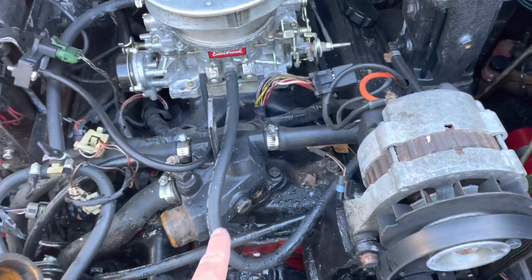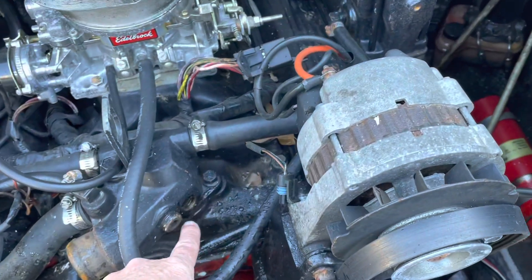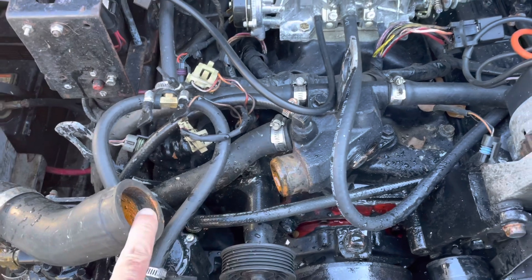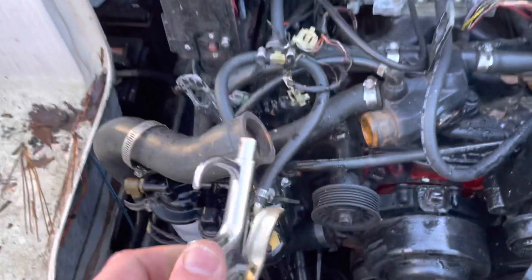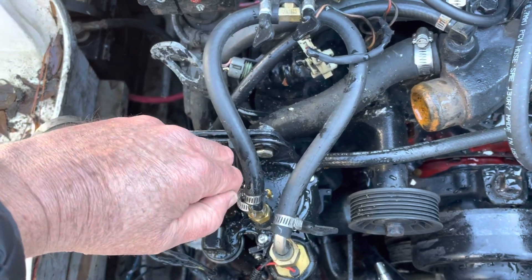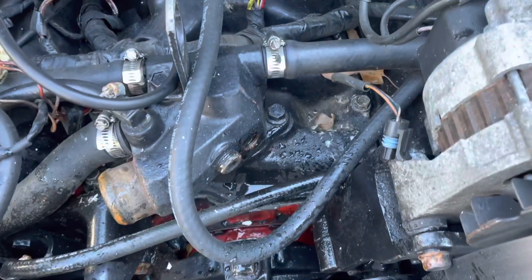What I just did was remove a temperature sensor that was in this thermostat outlet right here, and then I pulled the top cooling hose off — the one that goes back down to the water pump on the engine. I don't have power down here, so I pre-charged a compressed air tank before I got here. I covered this hole with my hand and put compressed air on it, and you can see the compressed air blew the water out of the engine.